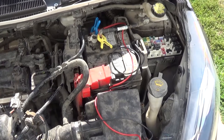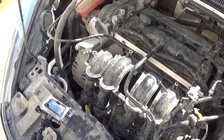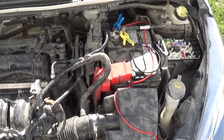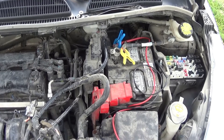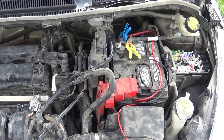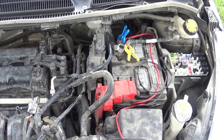It's working properly — only 7 milliamps. So honestly, why did this battery go dead? I don't know. I'm hoping it was a fluke, but it passed a load test, I've tested the alternator and it's putting out an appropriate amount, and there's no draw on it. Maybe it just sat too long and we didn't use it enough. This kind of stuff does happen from time to time — sometimes you have electrical gremlins that come and go. You drive the car, the wires bounce and move a little bit, and all of a sudden the problem's gone, then it comes back.